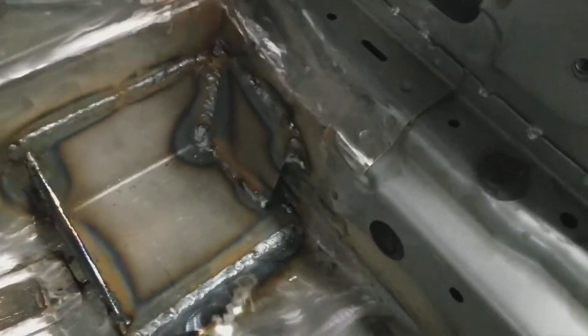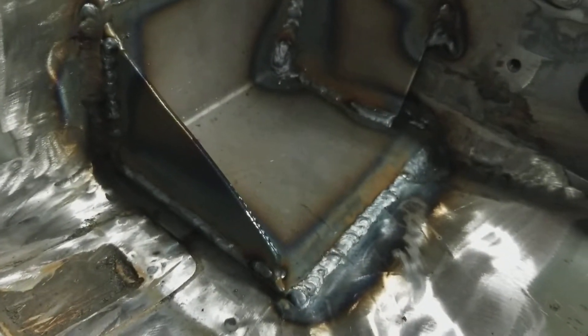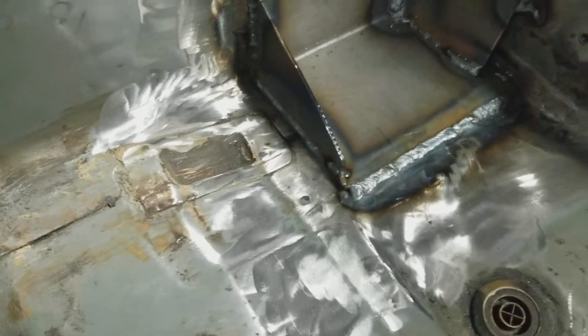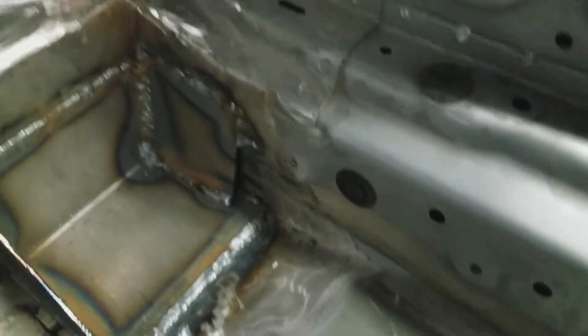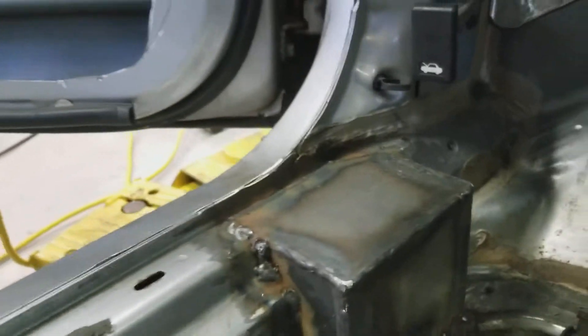This one's probably still a little warm, but I put this little side gusset off of that because below this channel right here is your main fuel line, and I didn't want to weld to the unibody right there and risk any stupid stuff from happening. You can kind of see that back there, but not great - but yeah, that's where we are now.